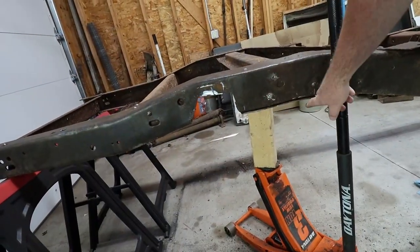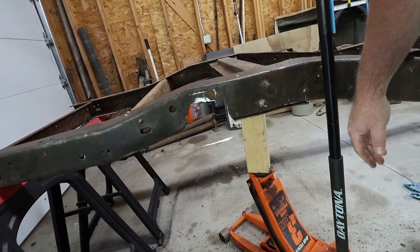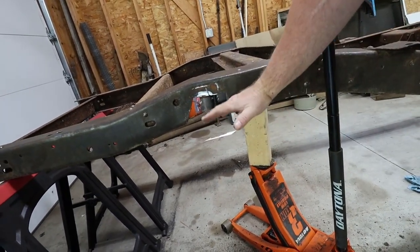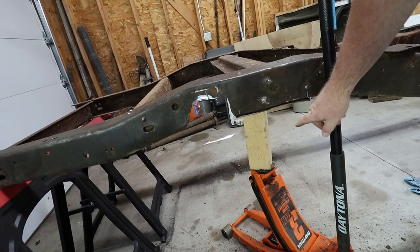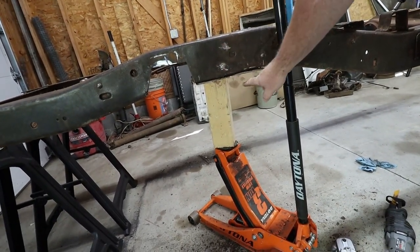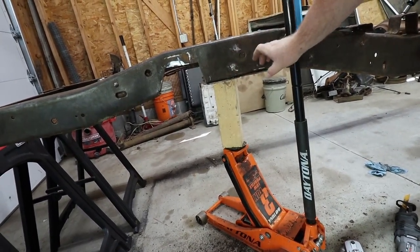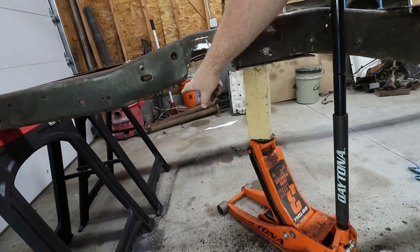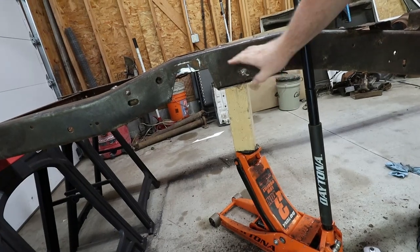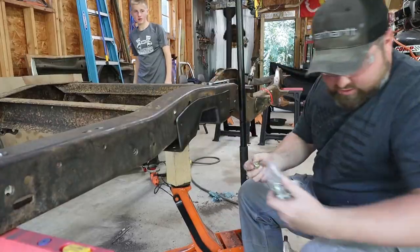Cleaning this up, getting it out of there so the metal's not swollen. Yeah, that's a must because it pushes that bracket down and then you're not flush back there. So we gotta get this all to fit up tight. We'll bolt on the bottom part here first. We'll smash these two pieces of metal, squeeze it all together so it'll have a true line as it gets back to here before we drill this or drill any of these. So bolt these two up first, figure out where you're at, and then use the markers to drill your new holes. Try this one.